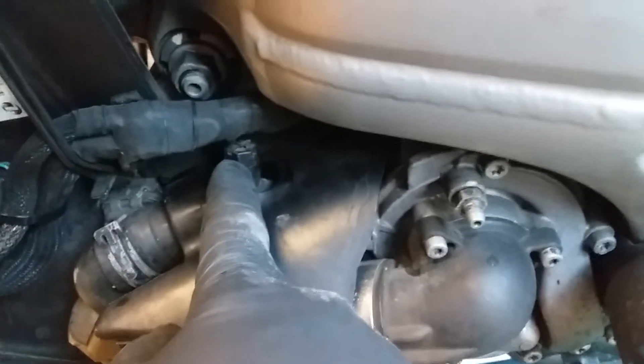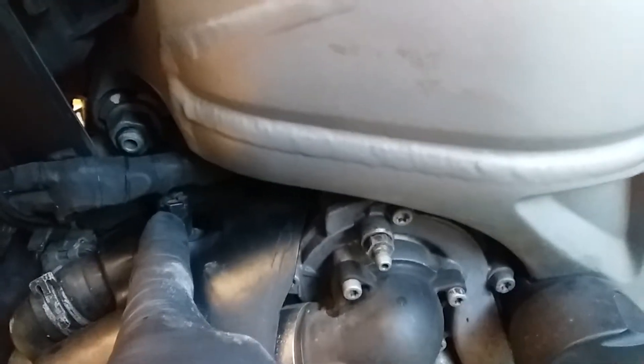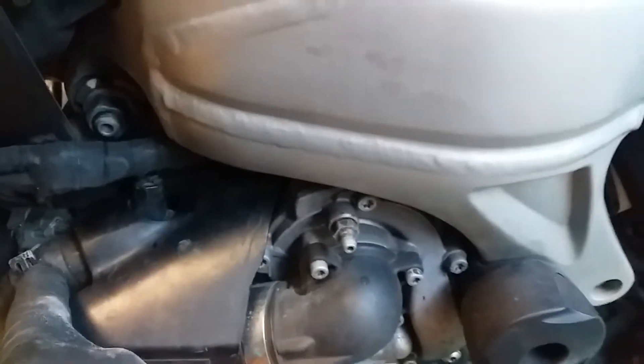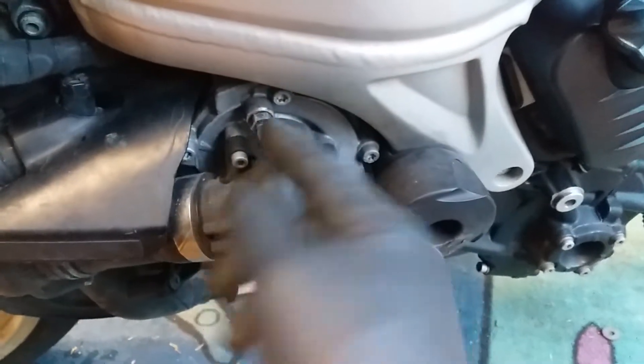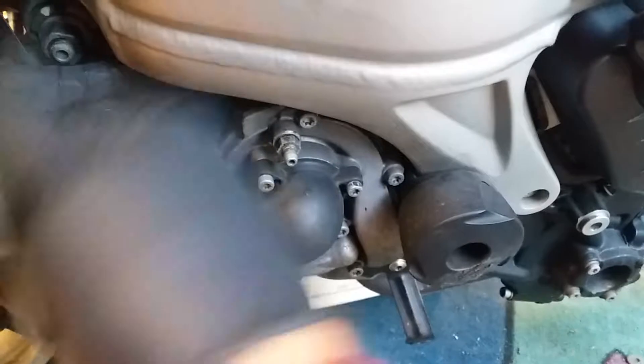While you're on this side, check with a 15mm spanner that you can loosen this plastic bolt — it's got an O-ring on it and will feel a bit funny. It's an air bleed point. Then on the water pump just here is another one, just like your brake calipers. Make sure you have a ring spanner so you can put a hose on it.